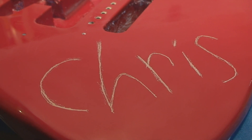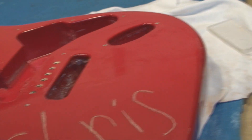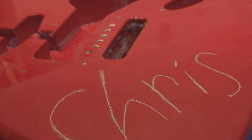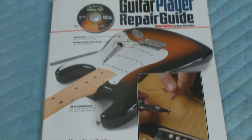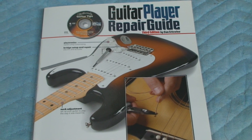For touch-up purposes, Dave has let the cat out of the bag — you can mix lacquer with polyurethane and get away with it; they'll like each other for the most part. Let's see what happens. I've got to mask this whole thing. I'm just going to shoot the whole face of the guitar since the pickguard covers so much. I'll cut right at the radius, right at the bend.